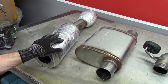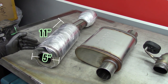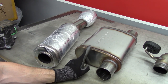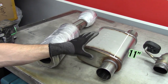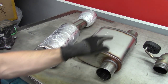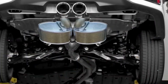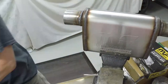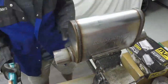Now that I've got the Magnaflow kit cut apart, we've got the original muffler that came with the kit, which is a 5-inch round by 11-inch long muffler. I've gone ahead and with the help of Magnaflow selected a new muffler — part number 11376 — and this is a 4x9x11 oval muffler. It's got an offset in and out, which is going to allow me to mount this in the exact location as the round mufflers. Overall dimensions are exactly the same, so it shouldn't have any issues with clearance. Now it's just a matter of trimming down the inlet to match what was on the original kit, then getting the original Y-split bolted back on and aligning the new mufflers properly.